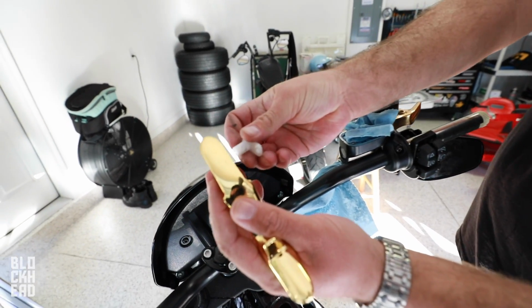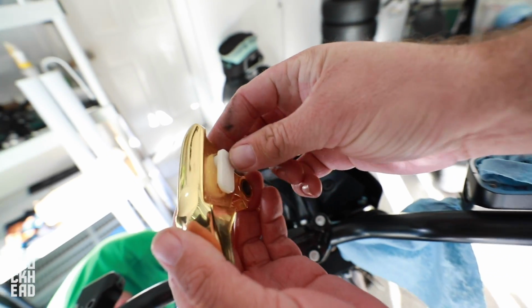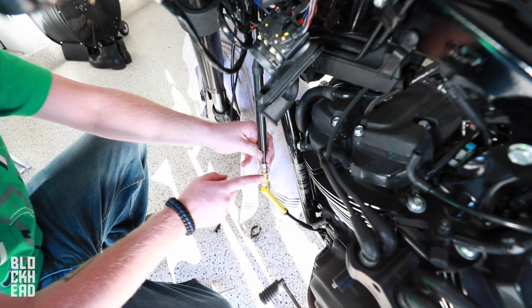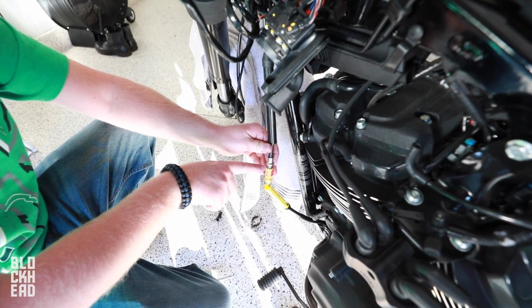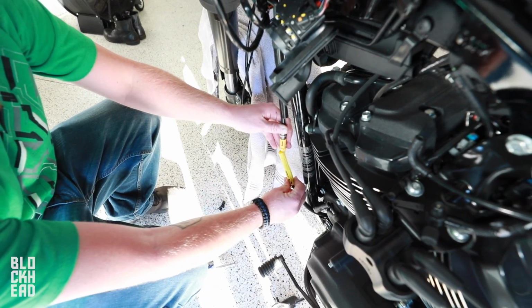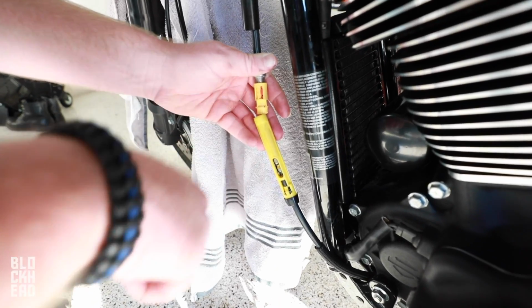So you guys know how to take the levers off. It's just retained by that little piece of plastic. Just like that. So you pull this out, take the plastic off, and that's it. What you do is you compress this, push the lock back in, see how the spring is compressed. Now you have all the extra play to where you can get in there and undo it.